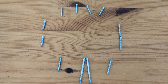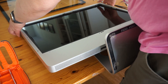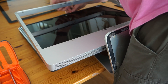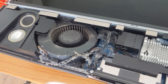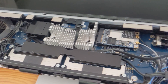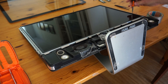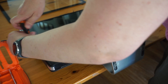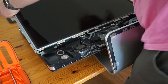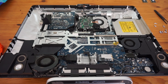This is the order in which the screws came out — not sure if that's the original order. It's quite dirty on the left side but not so much on the right side. Next we need to remove the actual screen by removing some T9 screws again and disconnecting three cables. And here's the naked iMac in all its glory.